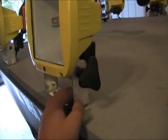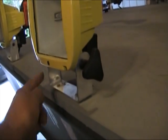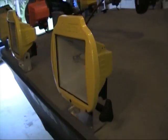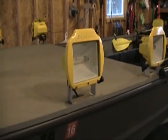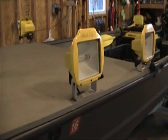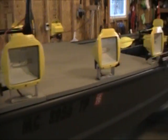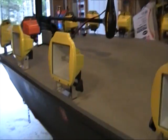With the lights, I made my own brackets — one-and-a-half inch aluminum pieces from Home Depot that I bent on my vice into the shape I wanted and drilled some holes. The brackets that come with the lights aren't bad, but they're not quite as sturdy. Since I leave these lights on here all year long, when we do regular fishing we can get into rougher water and the bow starts jumping around in waves, which is hard on the stock brackets. So making my own didn't cost much money, just a little time, but it makes them more durable and keeps them from flopping around.